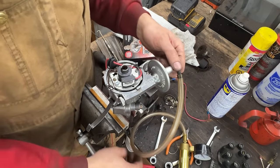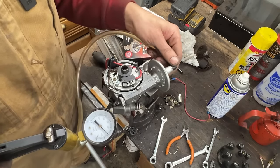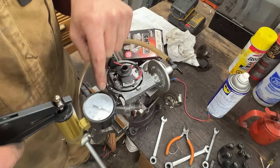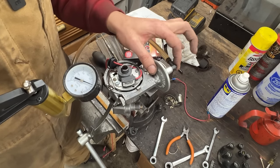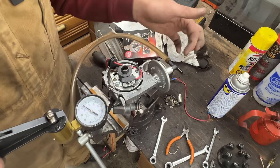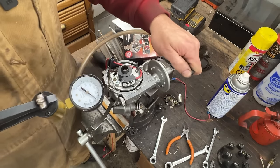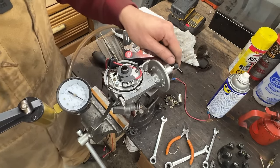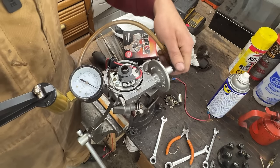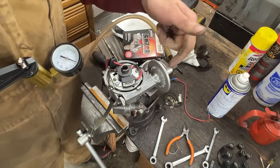Okay, now I understand what happened here. I got tricked by this fitting that everything worked. When I'm not pressing too hard on the fitting, that's when I'm actually getting the real situation here. You see, I'm building up vacuum. It moves a little bit, but then it loses the vacuum. What I did before was I pressed hard on this fitting, and that's when it started holding vacuum. But the problem is that now I'm actually forcing the end of this little tube here into the bottom of this fitting. I'm basically blocking my vacuum pump like this. That's all I'm doing. But if I have it pressed not all the way in, just like that, that's when I'm allowing the vacuum actually to suck from the vacuum unit, and that's when this moves, but it comes back right away because it's leaking somewhere inside.